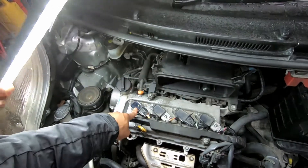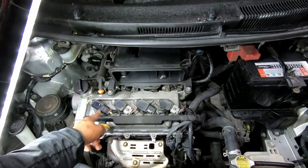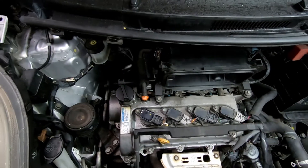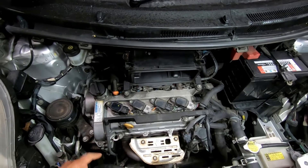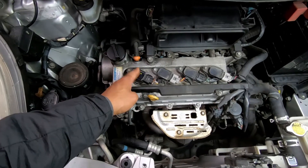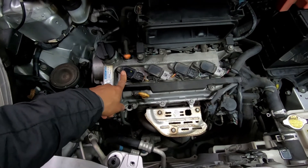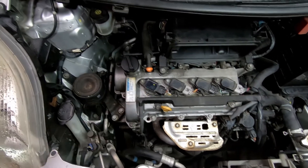On this particular vehicle, as you saw, the ignition coils are playing up. This coil is playing up — we did the test earlier, swapped it, and the fault followed the coil. Also, sometimes your PCV valve, if it fails, can also cause a misfire. And the last possible cause — if your engine is not being looked after — it could be a compression issue. Normally if you do the balance test like I showed you, you can isolate it to one cylinder. If you swap the coil but the fault still exists, you want to do further investigation.